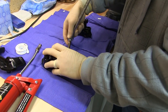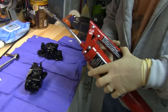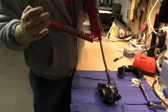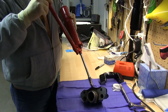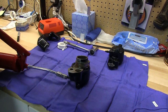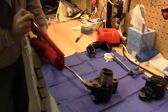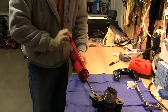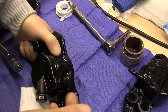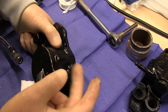Next, loosen the bleeder. Then you get your grease gun, plug in, and away you go. Little by little, out it comes. I can see there's some scoring on the piston, so I'll be honing the cylinder pretty good. It's out — power of hydraulics. The bleeder screw is flooded with grease now. I'm going to be putting brand new bleeder screws in mine — they're cheap, just get new ones.